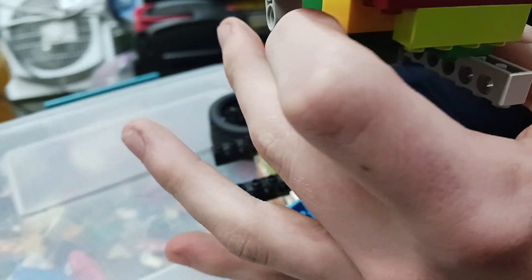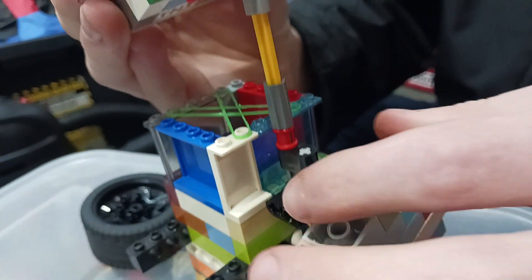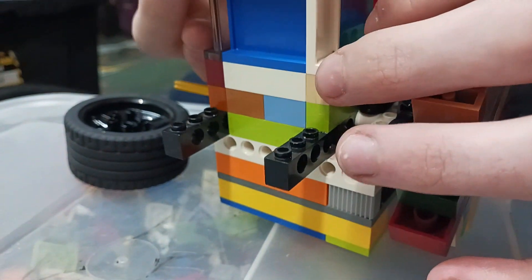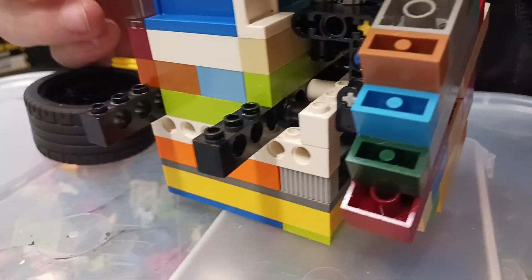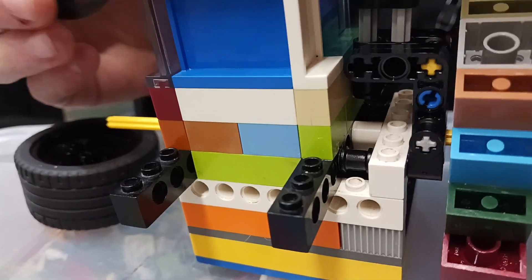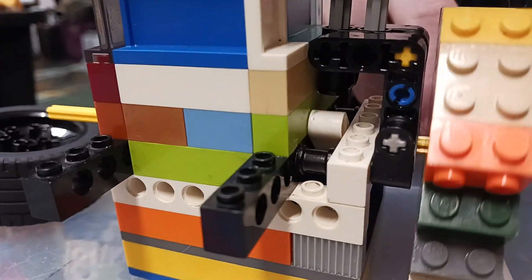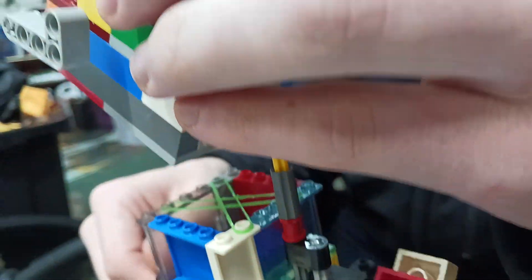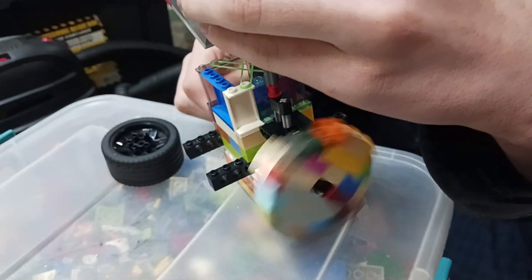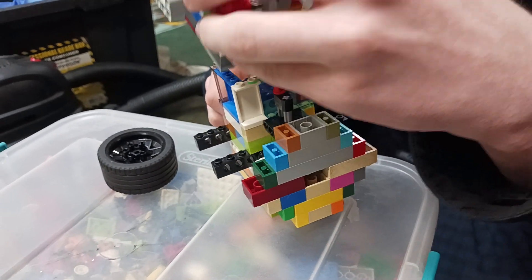The rocker pushes down, yes, and then on the back side is the push rod going down — it's a push rod overhead. Then you have your little cam lobe that rotates using the flywheel down there. There's the cam, and that would be considered a little follower up on top that pushes the push rod up. It's a very cool design — it actually sounds good, it sounds like a little motor.